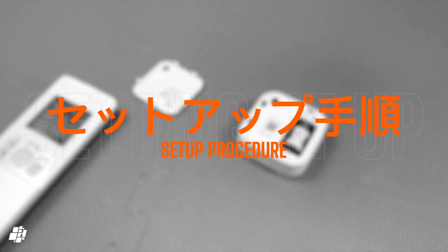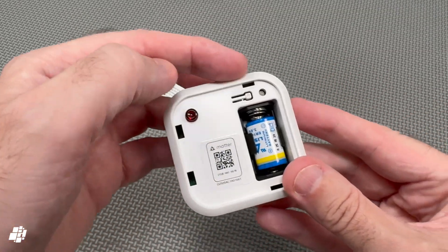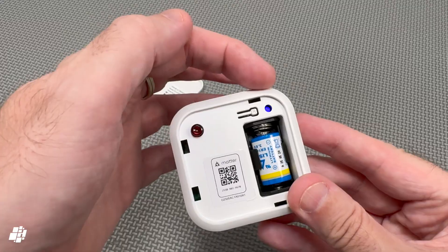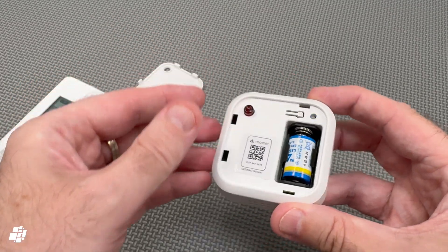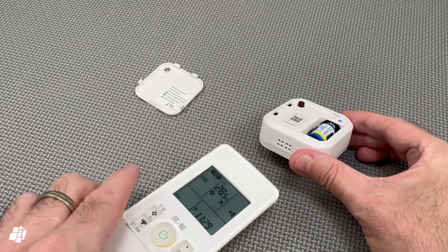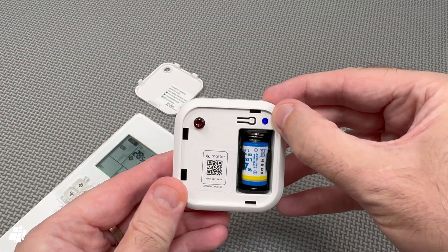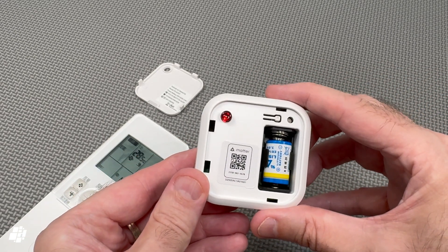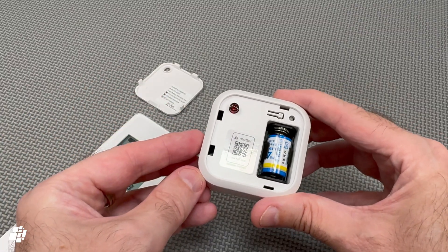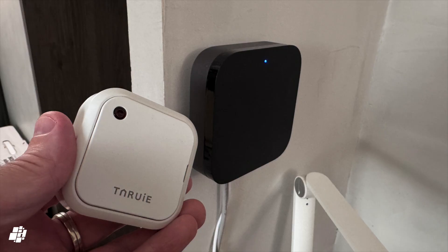When it came to setting this device up I honestly nearly gave up. First you put the battery in then press the reset button for roughly two seconds. A small blue LED will begin flashing, ready for pairing with your AC's original remote — point the remote at the IR receiver and it'll recognize the model, with the LED turning solid blue for a couple of seconds before turning off. After that you simply add it to your smart home using the Matter QR code. Strangely this never worked for me, but oddly I'd already paired my remote to an Aqara Hub M3 and was able to transmit the signal from the M3 to the AC controller without any issues.